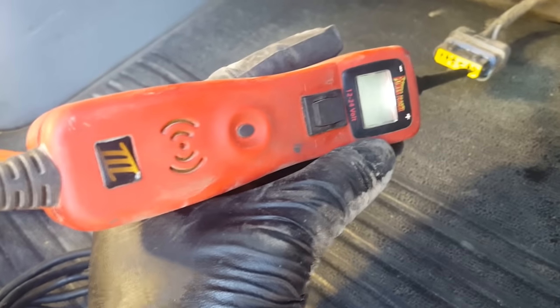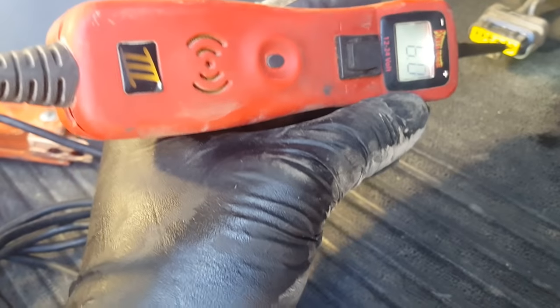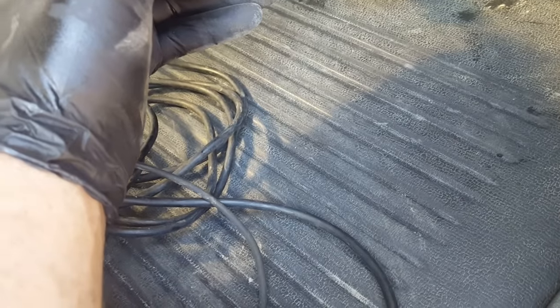So it just steps through different voltage levels — six volts down to about one volt depending on speed. I don't know the exact specs, but that's a real quick way to test it: if you're getting voltage and a good ground, your motor should be spinning. I knew this motor was bad because when I came over the first time, I hit it and it started moving.